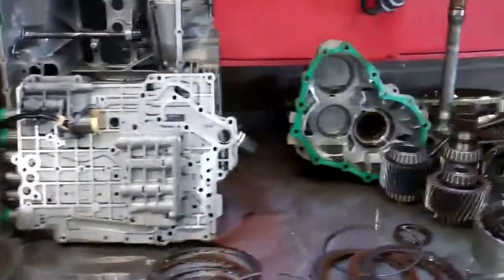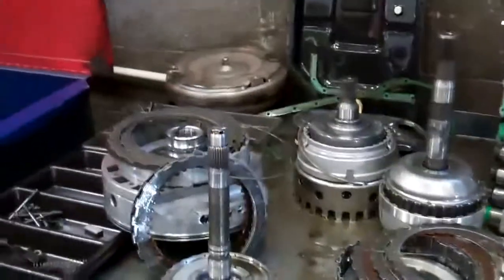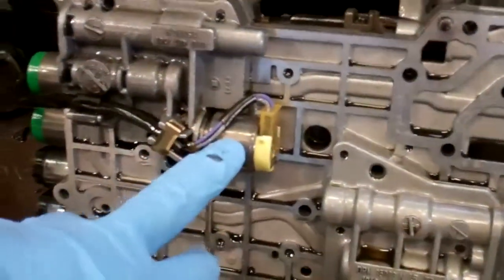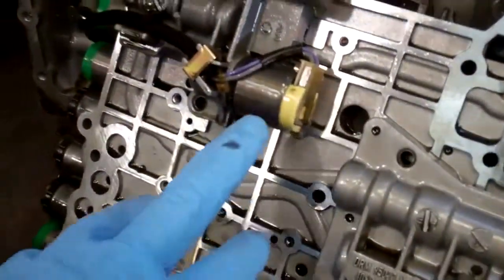Okay Candace, this is your transmission and we've got it completely disassembled. What we found is that there was some metal in the transmission. Audi has thoughtfully put magnets into this pan to catch that metal, but it doesn't catch all of it — all these magnets are just buried in metal. What happens when it gets metaled up like that, it'll affect electrical components like these solenoids that control the oil pressure. They're electromagnetic, and it'll make them run excessively high oil pressure.